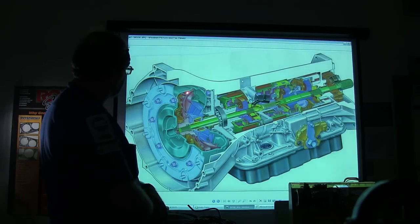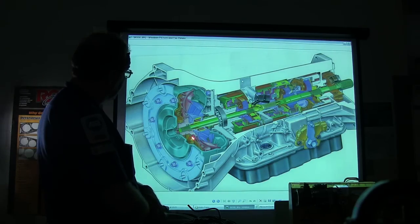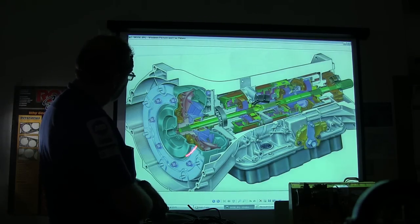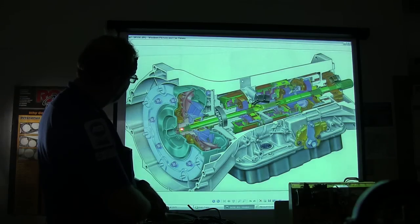You're calling it a turbine shaft because you see this red part right here? This red part turns out to be the turbine. Whenever the engine is spinning this part of the torque converter — see how it's bolted to the flywheel, here's your bolt for the flywheel — when it's spinning that, this doesn't necessarily have to be moving.